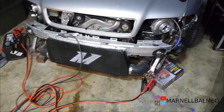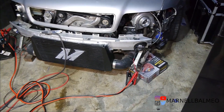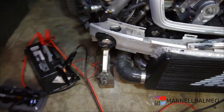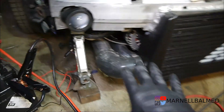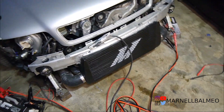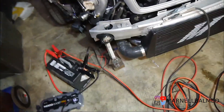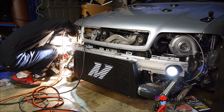Alright, so I'm continuing from last week's episode where I'm mounting the headlight. I do have it pretty much angled — I did have to cut this part a lot more and I did the same thing for the other side. It is pretty low, about 15 inches off the ground, so that will be my marker. I'm gonna go ahead and weld it — we're gonna do some aluminum welding. Hopefully I can tack it in place, take out the headlight, and not melt anything in the process.